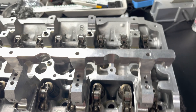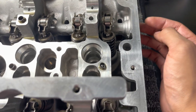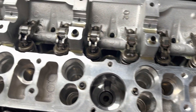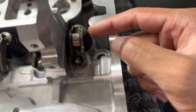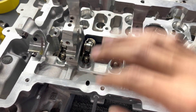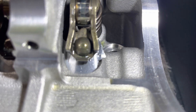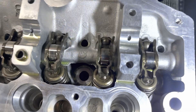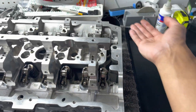With all the valve springs in, I went ahead and put the lifters back in as well. Before doing that, I flushed them out with some cleaner and then reprimed them with oil so that it's all clean inside and out, since I don't know what the condition of this engine was when I picked up the core. These are at different angles, so make sure you do not mix these up. When I took them out, I put them on a piece of paper in order by cylinder and by side. You can see in there it says number three on the intake side and six on the exhaust side — three degrees on one side and six degrees on the exhaust side.